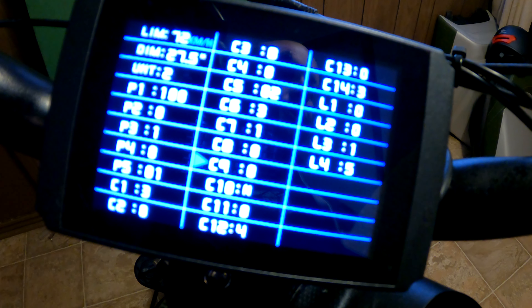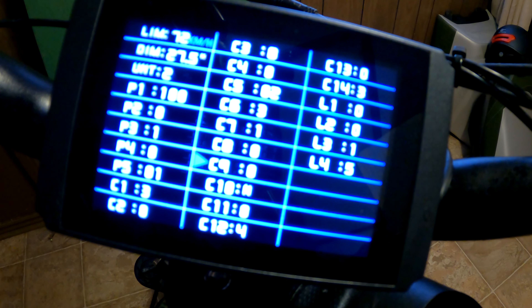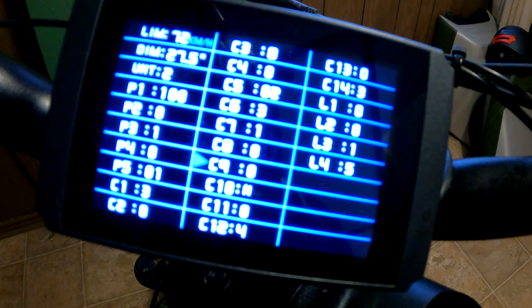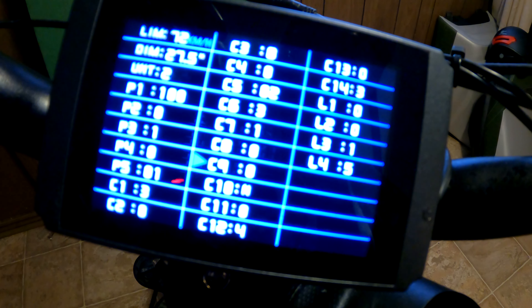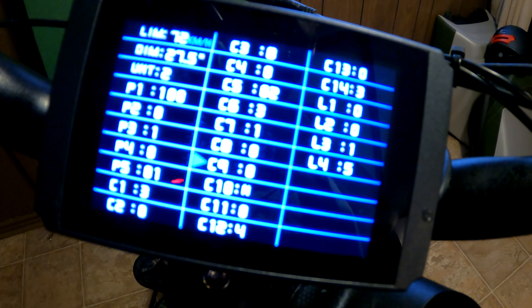C9 is your password. I don't have a password on this bike because if you forget your password or enter it wrong and can't remember how to access it, there is no way to reset that password without having to reprogram the whole controller. The password, when set, requires you to enter it before the bike works — it helps prevent theft. But knowing my forgetful mind, I just decided I am not going to do the password.